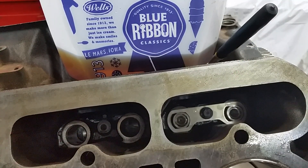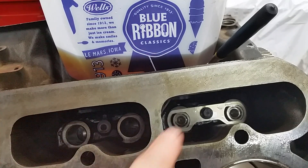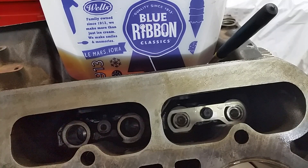The engine is coming together well. It's taking a lot of time but I keep getting pulled off for doing other stuff - we had to just about rebuild a mower because it's grass cutting season, and then of course work. But other than that it's not a big deal. I'm going to stop the film here - putting lifters in is not a big deal: slide them down the bores, put the plate in, torque that to 15 foot-pounds. Not a big deal, so we'll move on.